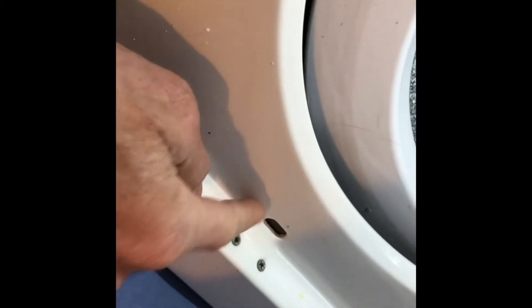So we're going to unplug it or turn off the breaker. Here's me unplugging it — it's nice and safe. Right here these two screws can be pulled out — Phillips head screws — to get to the lid switch.